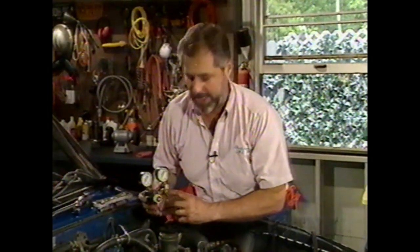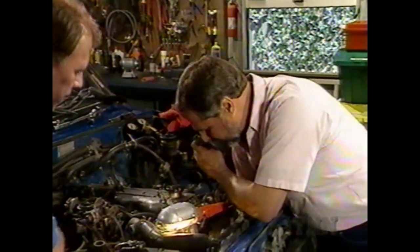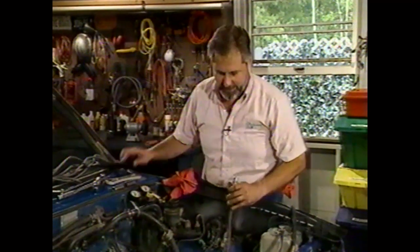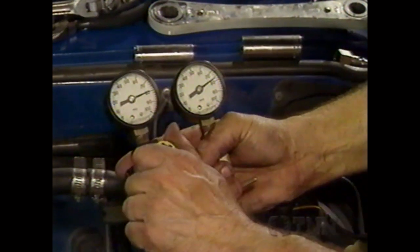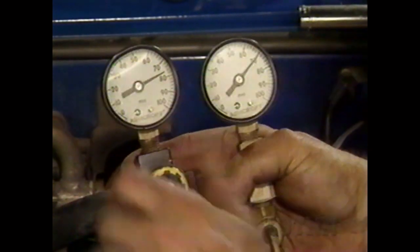To find out, we're going to do a cylinder leakage test using a compound gauge with compressed air through a regulator to see how much air the cylinder will hold. First we set the engine to top dead center by rotating the engine and listening for compression — I've got an airline laced into the number one cylinder. When I come to the compression stroke, I should be able to hear it. You want it right at top dead center — that's critical, because if you add compressed air when you're not at top dead center, the engine can roll on you. You can also check it with your distributor. Connect the line to the cylinder, set the regulator to about 80 pounds, and gently open the valve.